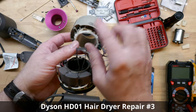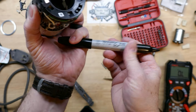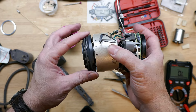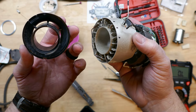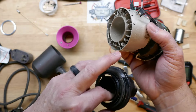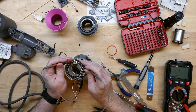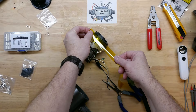You may want to mark where the NTC and ionizer bar go before you take the cover off, so it's easier to line up. Once you know the front cover is keyed it only goes one way — I'll show you it fits well, but you need to know that so you don't try to force it. The reason it goes on so well is because of these little slots on the edge, 180 degrees across. That's where your power bus comes across to your heating elements, so you'll have 120 volts on those as they come across the mica that feeds power to your thermal fuses.